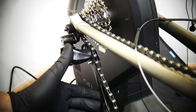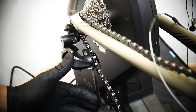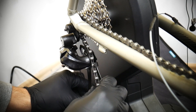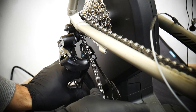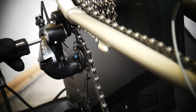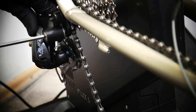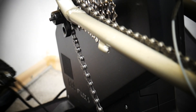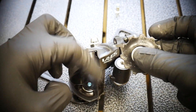When you don't want to break the chain you just open up the plates. Remove the tension pulley, which is the bottom pulley, and then just a little bit more here. Do it slowly because you can put too much tension on that little bolt for the guide pulley, but once it's open you can remove. Hold the derailleur while you're doing this - you don't want to damage the thread on your frame, on the hanger and on the bolt.